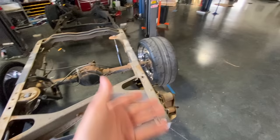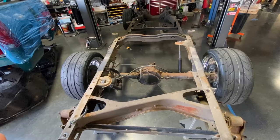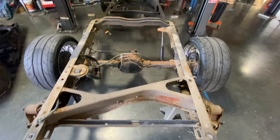Also got bigger wheels and tires. Mustangs, they got the 10 speed. Some of them come with a 3.55 rear gear. So you can get pretty crazy with the 10 speeds, but we want to have a nice cruiser here. So a 3.09 gear is going to be our best bet.